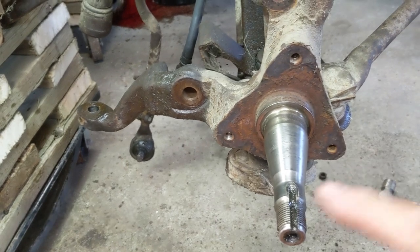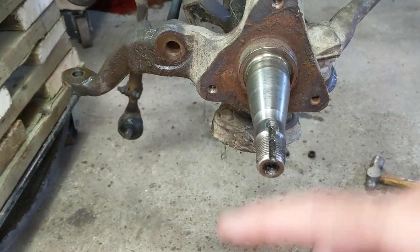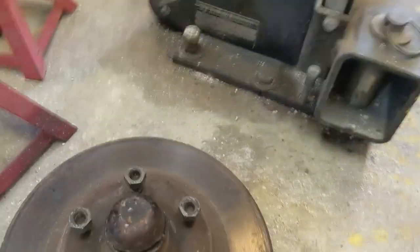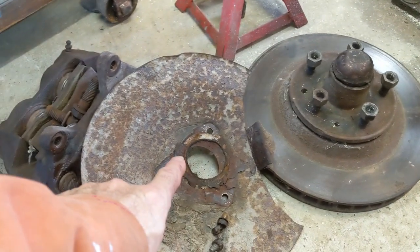There's the rotor off. Pretty simple. Like you saw me take off the spindle nut, the cage spindle nut, a cotter pin cage spindle nut. I just keep them all together. I put them back in underneath the cap with it. And then there's the backing plate.